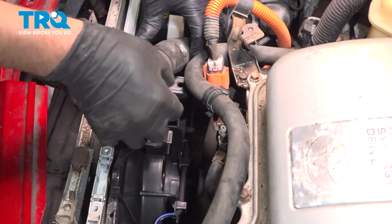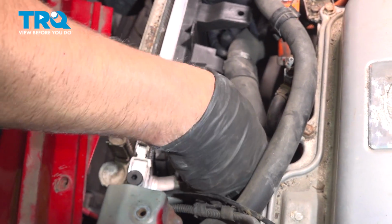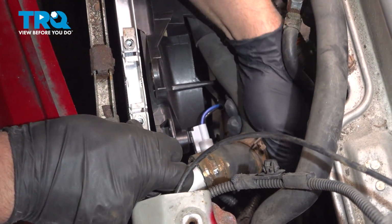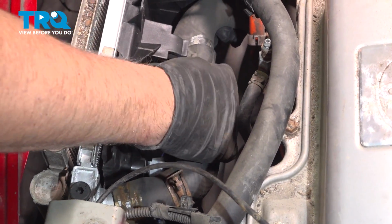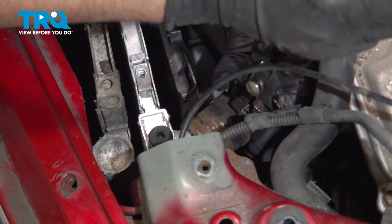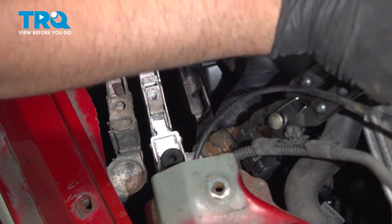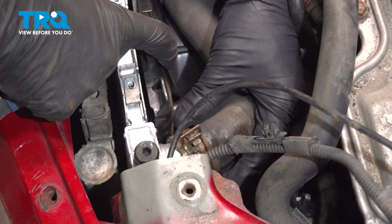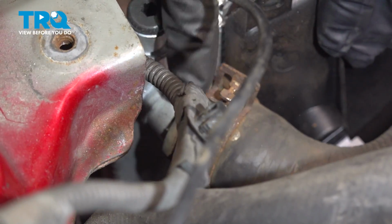Take the coolant hose. Get this lined up. Slide it on the radiator. Now we'll move the clamp. See, that gets pushed right there. And slide that in place. Releasing the clamp, I'm just going to use some pliers. Just squeeze that like that, and now it's set.